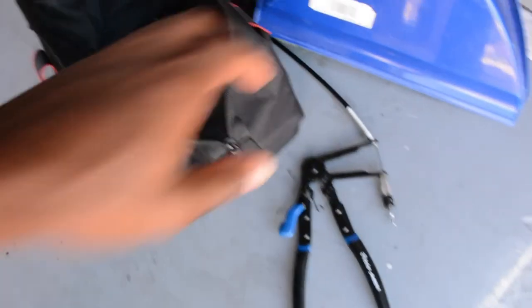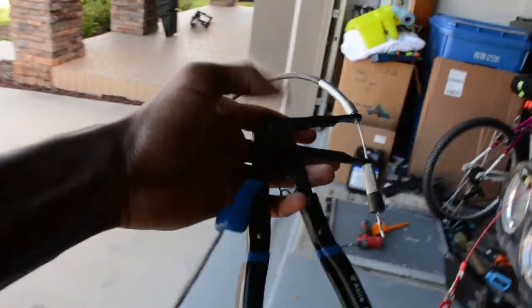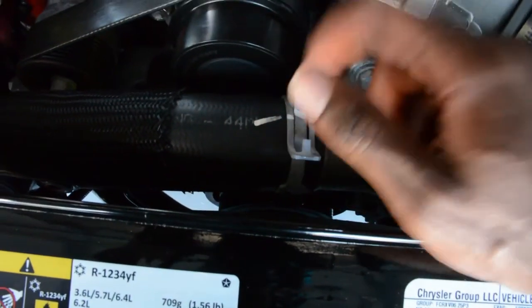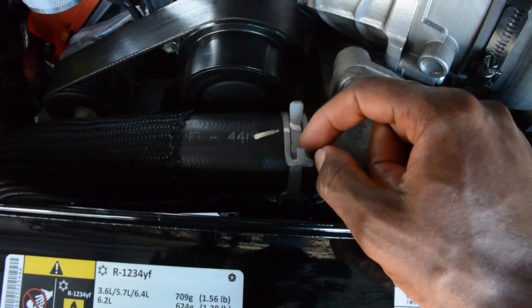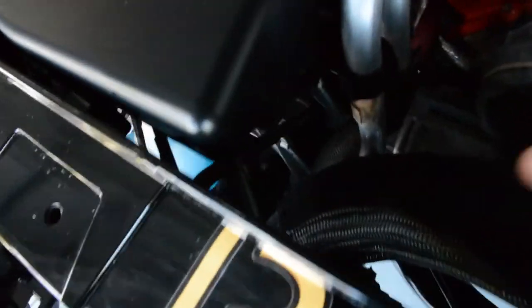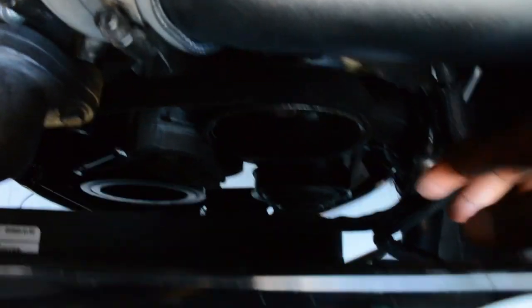That's a testament to purchasing tools if you're going to do your own garage maintenance. You don't have to have mechanic-grade tools, but you've got to have some good stuff. This tool right here was absolutely invaluable — this is a hose clamp tool. If you're going to be dealing with those really hard spring clamps that are on the hoses, it's a great idea to get one. It was $39 on Amazon, and I would not have been able to move those hoses without it. The radiator has two big hoses — one that goes in right here and another way at the bottom.